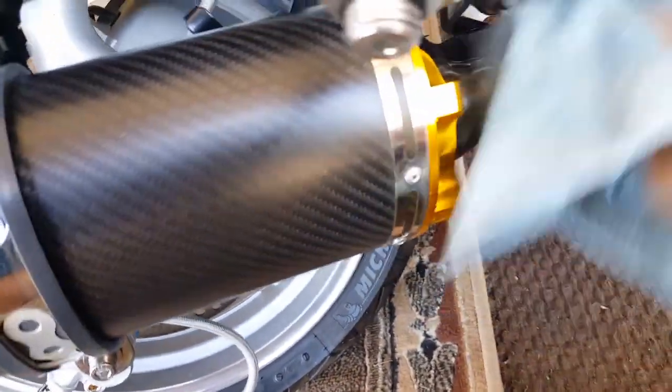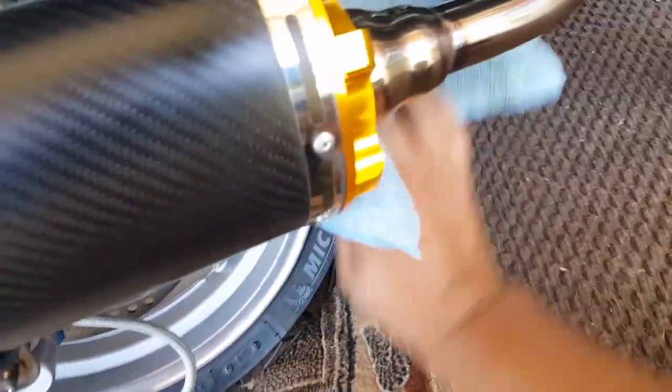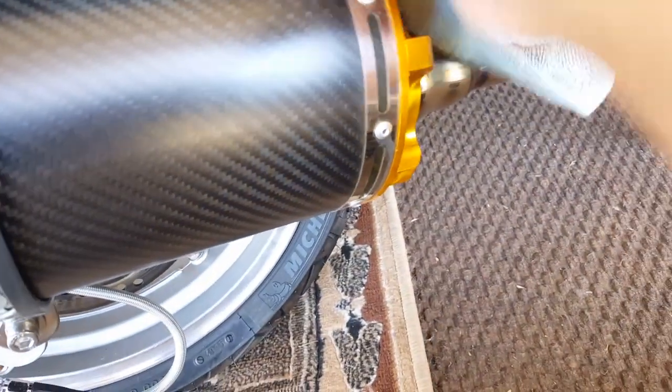Now, actually, when I shot air back through here, it squirted out whatever fluid was in there. I'm not sure if it's a good thing or a bad thing. So it might have a little bit of exhaust leak, but only from this muffler joint area, which is probably common because there's not really anything to seal it. We don't have any kind of gasket. I'm surprised they didn't give you one. But there's a gasket in the cylinder head, which is important because you don't want exhaust leak there. Also, it would stain the whole area, and then you might not have good compression, backflow.